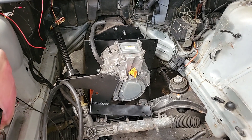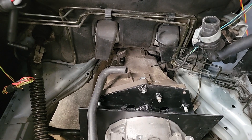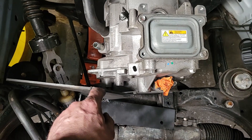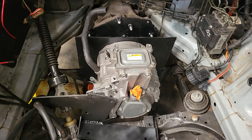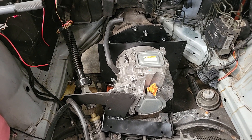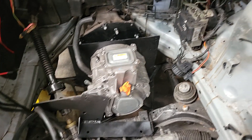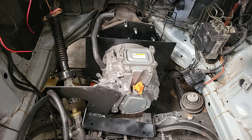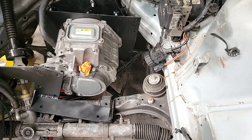This is where we're at. The motor is sitting too far forward — not very much. If you look straight down you can see it has to go back about two centimetres, maybe a fraction more, which is within the scope of the sliding part of the prop shaft and the adjustability in the gearbox mount. But I can't move the thing — it's too heavy. Probably need to get the engine crane back on it, and I'm topping out in the gearbox tunnel trying to lift it. I may be fouling on the X-frame underneath, which may need to come off.